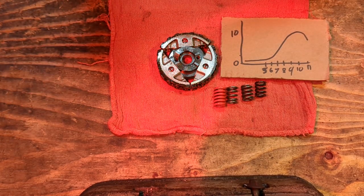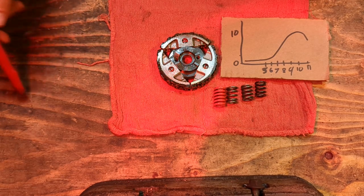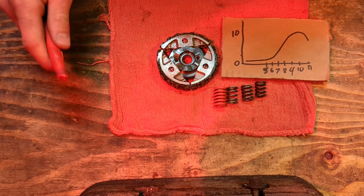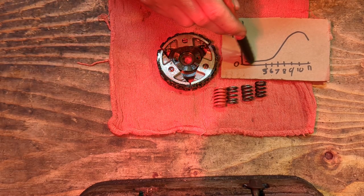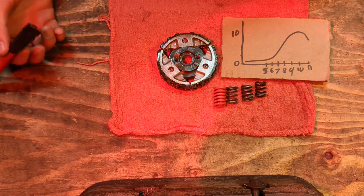So it's one way to think about it. If you're in a stick shift car and you put the gear selector in third gear, you can start the car in motion. It takes a lot of slipping, and once you actually let go of the clutch, the tire speed is directly linked to the engine speed, and that might be at a couple thousand RPM, maybe two and a half thousand RPM. If you floor it, it'll take forever to make power to actually go up to 60 miles an hour, 50 miles an hour in third gear, because you're pushing a 2,000-4,000 pound car, and you're in the wrong gear ratio, right? And that's what happens if you try to start in third. You're fighting the entire resistance of the car with almost nothing being produced by the engine. And there's no way for the engine to make power until the wheels start actually traveling fast enough.